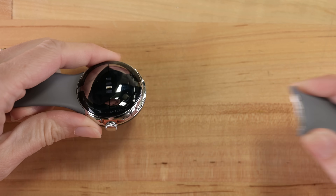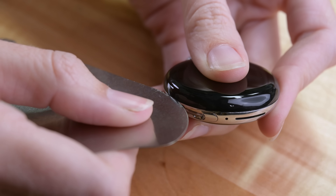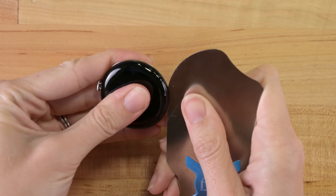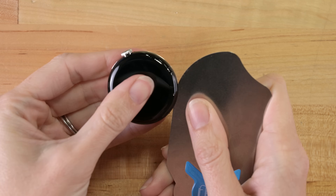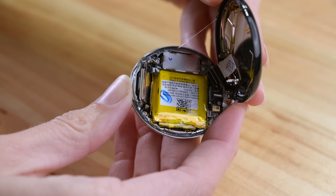I actually kind of love the way these straps slide off. That underside seam looks pretty tight, so let's heat the top case. The iFlex slips right in — hopefully that crown won't get in the way. This adhesive feels surprisingly loose, but as we peel off the last bit it does have some grip, so hopefully that IP rating holds up. The cables have enough slack that I managed to avoid slicing them, though there's no way to disconnect them yet.